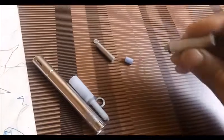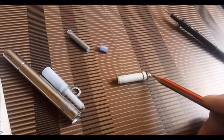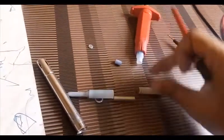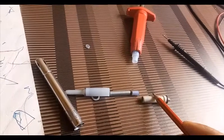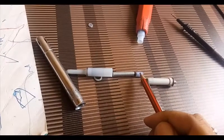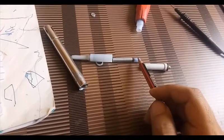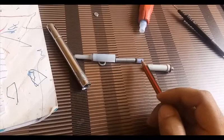This is the main part — this is called the piezoelectric crystal. This is the total portion inside the plastic cap. The plunger comes and hits this portion. All components are inside like that. When the plunger presses this, it converts force energy into electrical energy, because piezoelectric material converts mechanical energy into electrical energy.